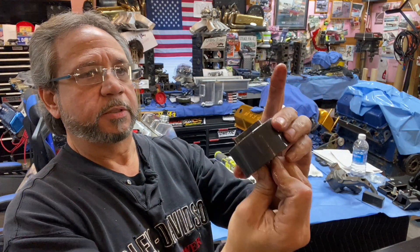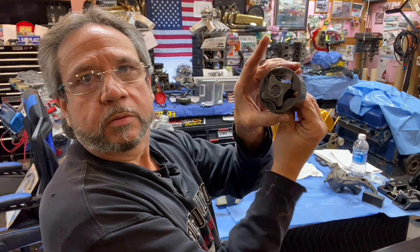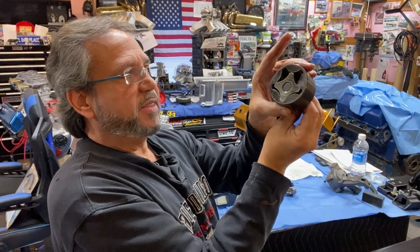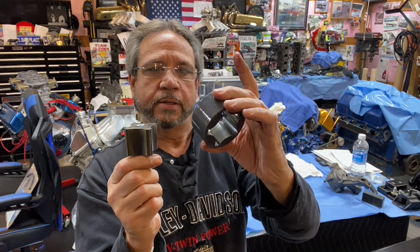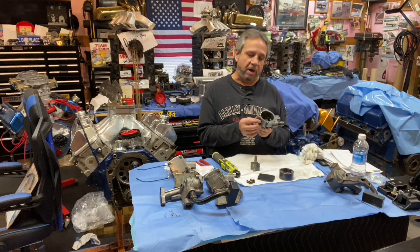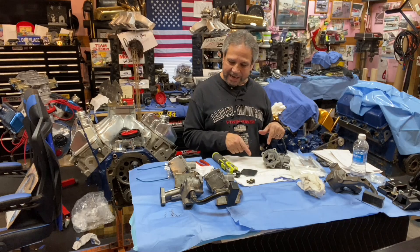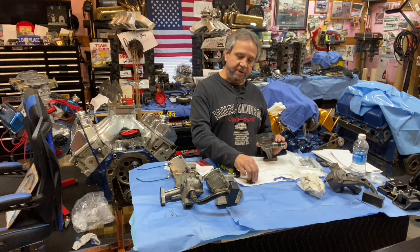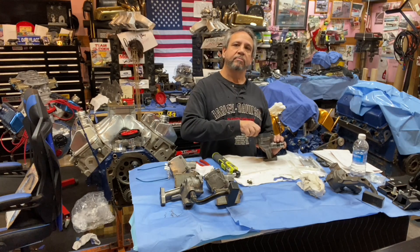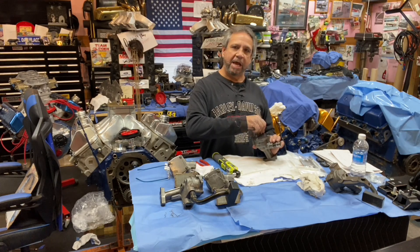You can see the outside coating has some areas of wear — I suspect that's normal, we'll see what he says. The difference between the high volume and standard volume is the length of the rotor. That's what's inside a Precision Oil Pumps high volume blueprinted oil pump. I'm going to put this back together, ship it back to Doug, get it rebuilt, and use it in the next build with Bob Beach — which is going to be a high port Cleveland.